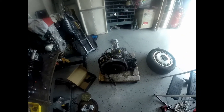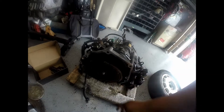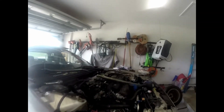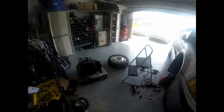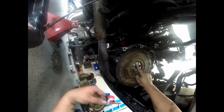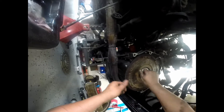It came out with the starter, so you're going to have that bolt back here, these two bolts, and then these other guys. There she is — now there's a new one going in. I got it right now — remove this bolt right here, put the flywheel on, get all that set up. So right here I got the flywheel already on — you see this right here, that's your guide for the other side, so the flywheel can stay in place. Putting everything back together.